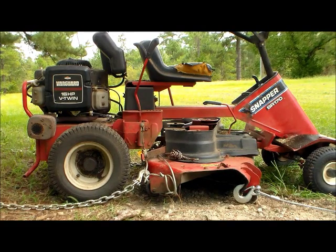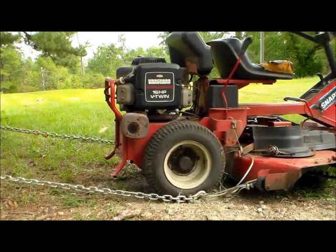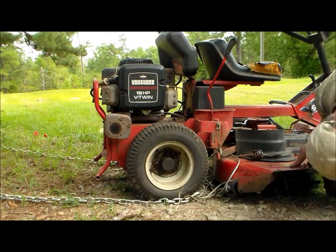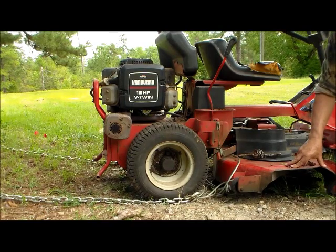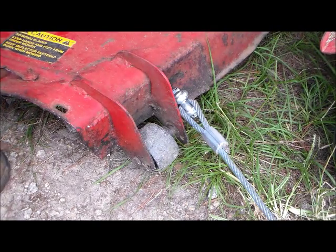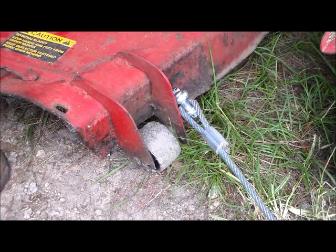The entire mower may move slightly as we apply pressure. We did open the front of the mower deck. The blade can turn and not strike the deck. Our efforts were successful. Now, a reset of the hook on the other side and another pull — it's now adjusted to being pulled almost straight. This wheel turned, so that's as it should be. We made great progress there.